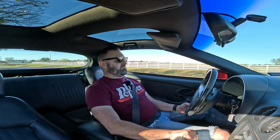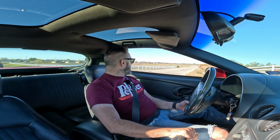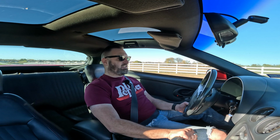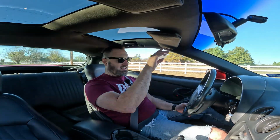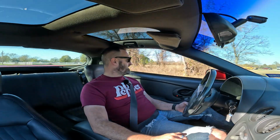It's on the low resolution side of the Opti, and I know that's what it's running off of right now. The high resolution side, think of that as the cam sensor on an LS car, and the low res side, think of that as the crank sensor. As long as it sees a crank signal, it's gonna run. That disc has multiple slots in it. The low res side has a couple, and the high res side has 360 slots in it. That's how it fine tunes things. I guess it would be in batch fire if it was in the low res side. I'm not really sure how it works, but I know it has to fail for it to start. So yeah, that's the issue we have right now.